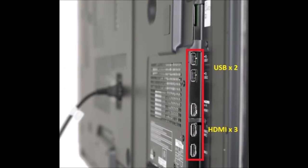In my case, my TV is already wall mounted and there's very narrow access to get behind it. But I was able to look up the location of the connections online, then feel my way and insert the Roku stick into HDMI 2. I then took the USB cable and connected it for power into one of the USB ports on the back of the TV. Keep in mind: a red light will illuminate on the Roku stick if the USB port is not providing enough power — in that case, you'll need to use the supplied plug into a regular AC outlet, as some USB ports do not provide enough power for the connected device.